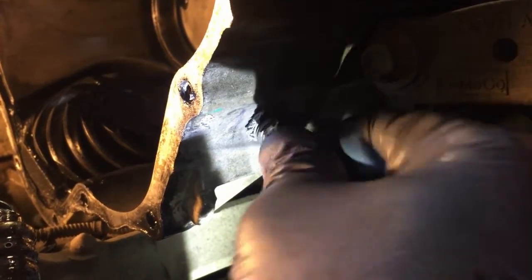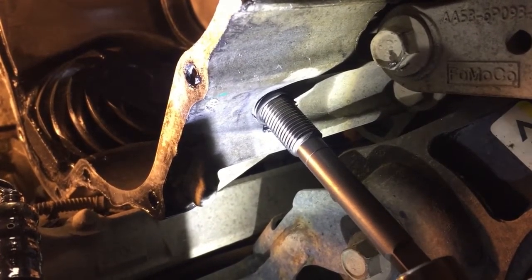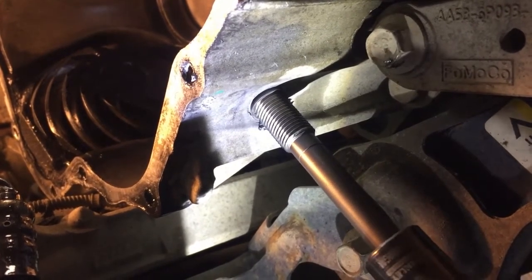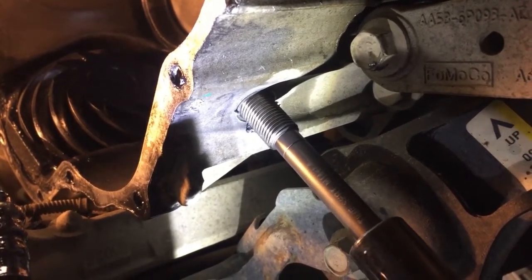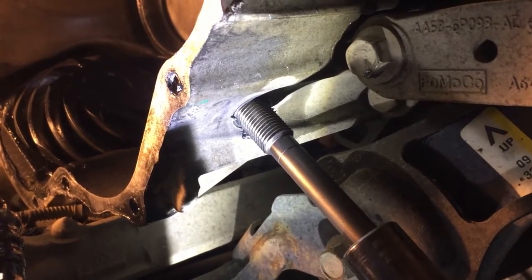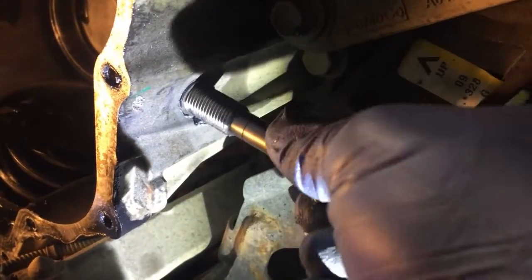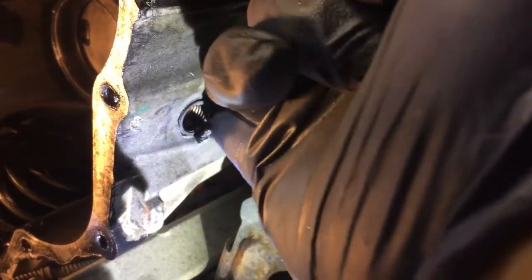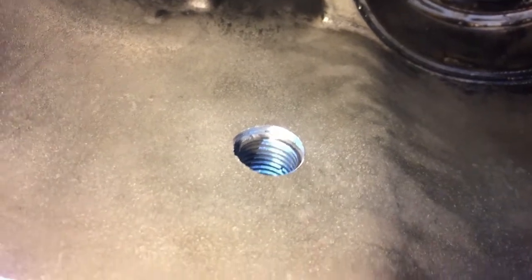Start by hand — I have a couple of threads already in there — and then I'm gonna use my special extension to finish this process. Very gentle on it. It's there. Remove this drive. The paste has been pushed out, so I'm gonna go around it. Let's double-check how it looks from the inside. As you can see, the thread sleeve is well below the surface of the PTU.